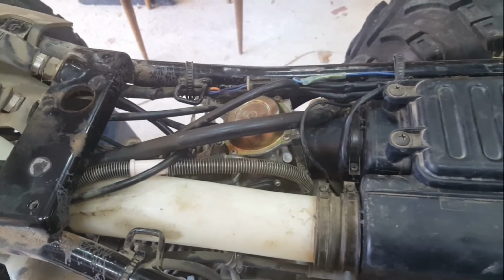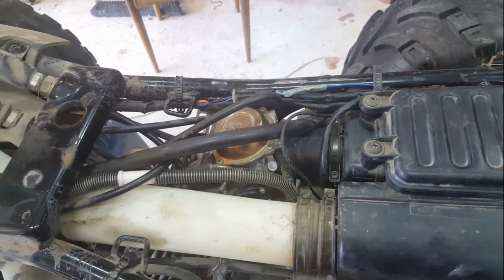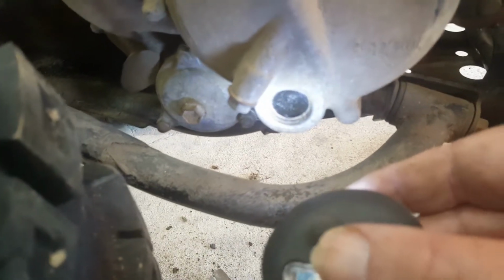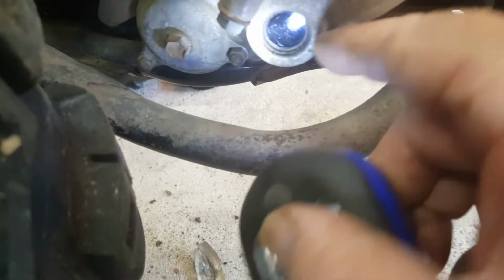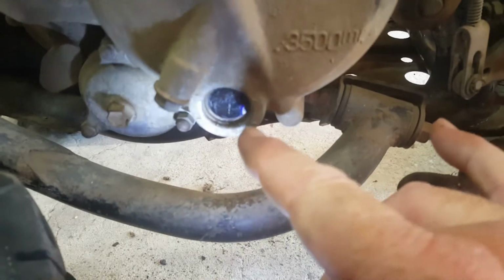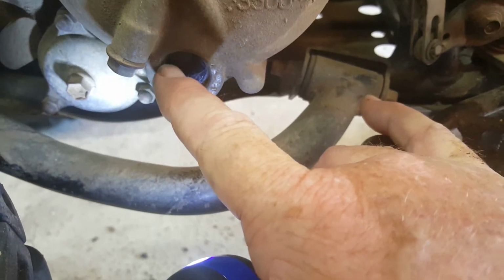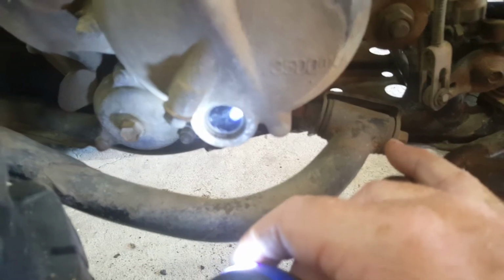can get it started. The other thing I want to check is the oil situation, because around the other side it looks like the oil is over full. That's the oil fill indicator there. It's either got none or it's full beyond the fill mark. There's two little marks on the side here, a high and a low for the oil. The high is up here, so you should see a little bit of a moon shape above that. I think it's over full.